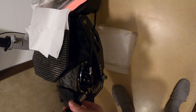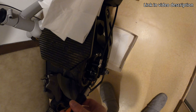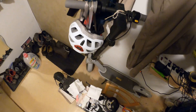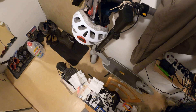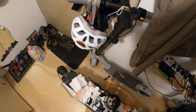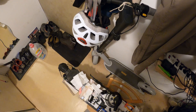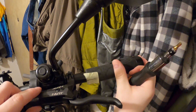Before testing the brakes you also need to completely secure the caliper and line it up in place so the brake discs are not rubbing. For a more detailed guide on this part you can check out my brake bleeding video where I included a section on how to align the brake caliper. Once everything is lined up and the brakes are working and no oil is leaking, you can press the rubber cover into place and then put the grip back on.